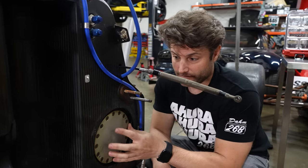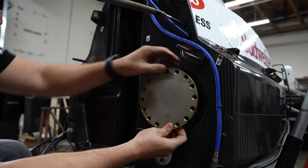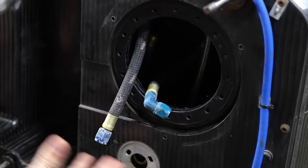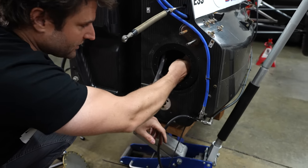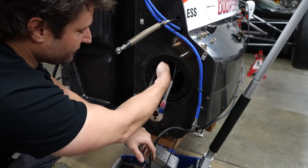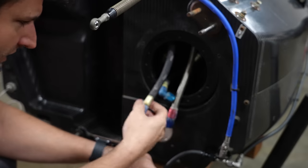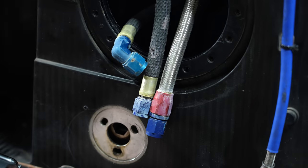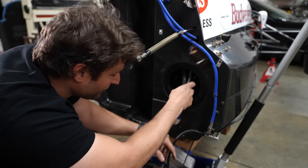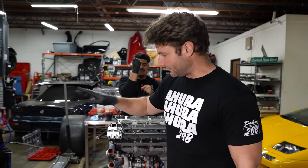We have no idea the condition of the methanol fuel tank. I've taken all these bolts off and we are going to see what's behind circle number one. Wow — that is an aluminum chunk of metal right there with a lot of stuff going on inside this tank. The tank is very wide and tall, not very deep, and they have multiple corners of hoses — I think there are four of them. This is actually a bladder — it's Kevlar, and it is a full-blown rubberized bladder. You're supposed to flush all the methanol out and run regular gasoline to neutralize what it would do to all of these hoses. They're meant for anti-surge, like a surge tank, basically. Now we know what the tank looks like — we can put some light in there and see more.